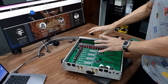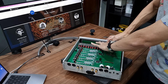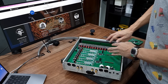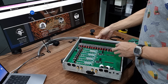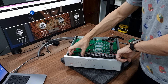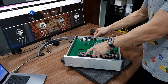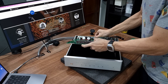Once we loosen all the screws here, we also have to loosen this flat cable. As you can see, the main board is already moving because it's not held at the back. Let me remove this flat cable slowly. The flat cable connects to the front panel — there are a couple of buttons there that allow you to control the DAC. The front panel has buttons and LEDs, and this control board is connected to the main board via that flat cable. Loosening it allows us to pull the main board out of the Pontus.